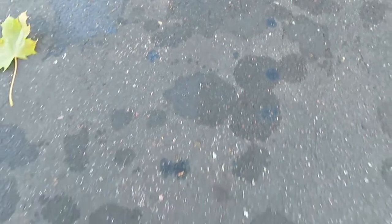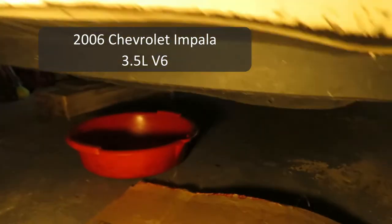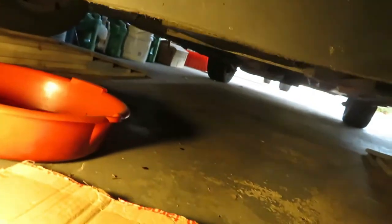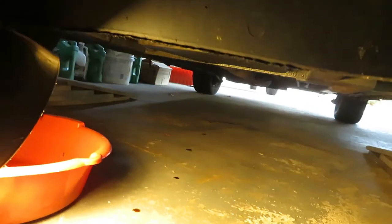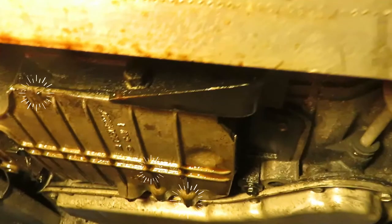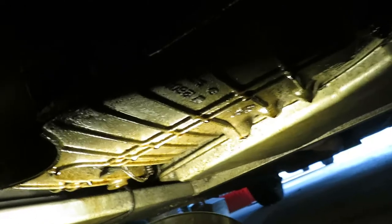It's like the place of a thousand drips underneath this '06 Impala. We're going to get under here and see where this is coming from. We've driven this up on ramps but it's still quite a squeeze under here. Despite the presence of all these drip points, the actual source is pretty clear — don't look any further than the base of the oil filter, that adapter right underneath it. That's what we're going after.